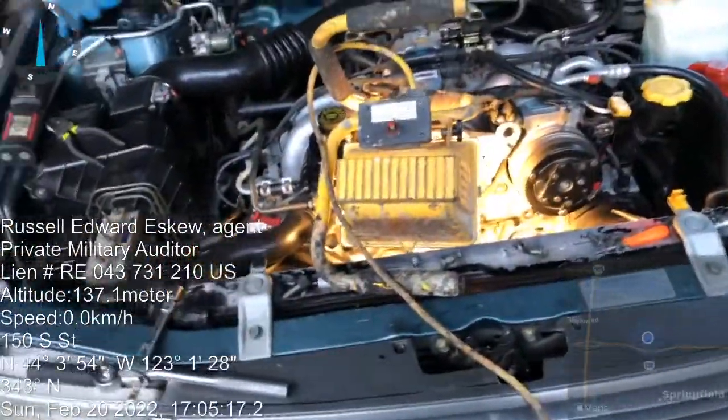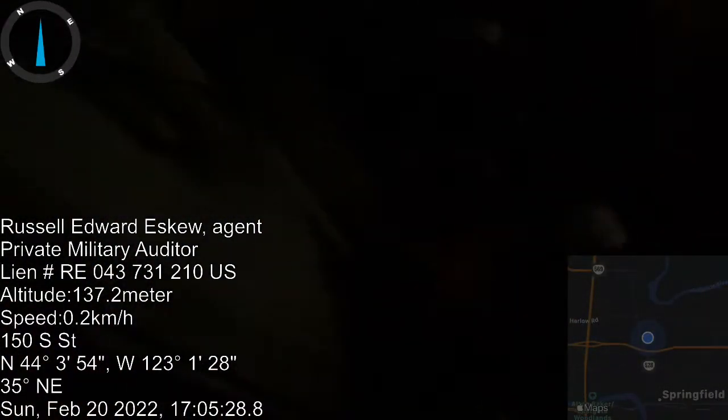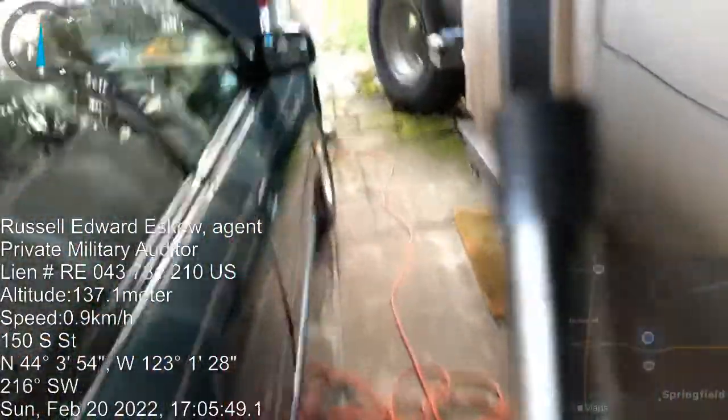However, I put a 10mm bolt through the housing, the tension housing here. I'll show you the tension housing. I put a 10mm bolt through this housing hole here, and it doesn't even fit in the housing hole. So we would have to drill that housing hole out if it came down to it, you know, if these threads fail for any reason. If the threads fail, so I'm gonna put some Loctite on this.